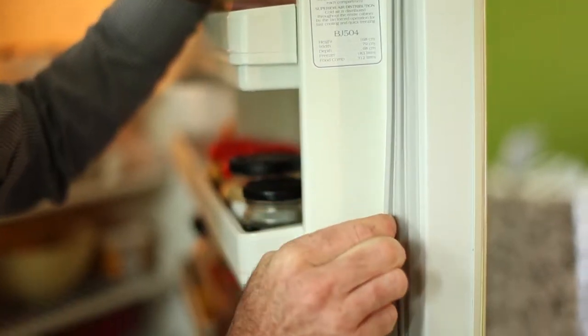And that brings us to the second part of maintenance. So we talked about looking at fridge seals. The second part of fridge maintenance is to actually make sure that your heat exchangers and everything underneath the fridge is kept reasonably clean. So if the heat exchanger is covered in dust and fluff and whatnot, that most people only move their fridge probably once every 3 or 4 years, and that means that it makes it much harder for the fridge to push that heat energy away.